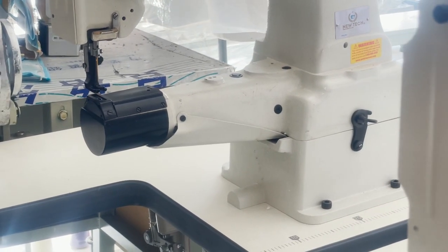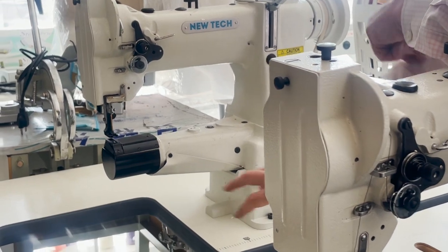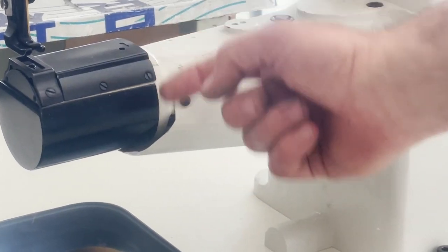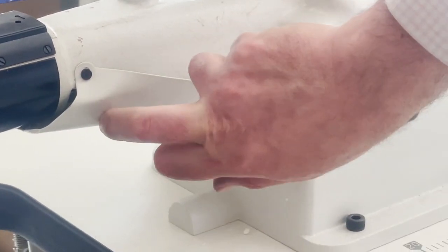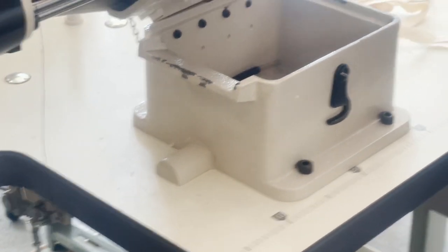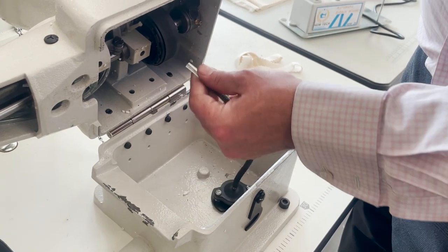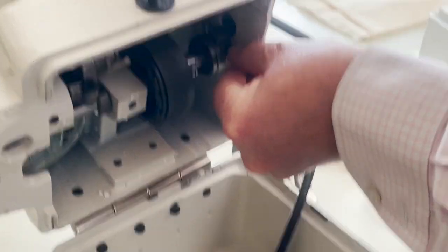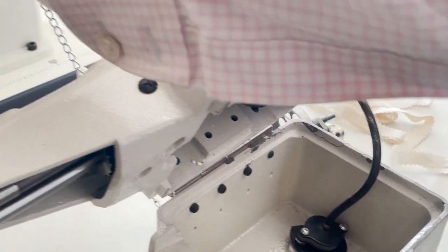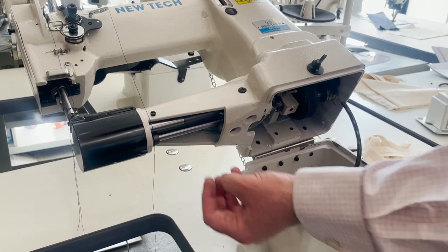Even the most sophisticated, fully automatic sewing machine has a drop or two of oil. But the way it works is you have to have this piece here. When the oil is inside and it's pumping, the oil might drop from back here, and this piece is there to take the oil and return it to the reservoir. You see — the oil goes in here. This is the pump. You fill this up with oil, it pumps in and goes inside the machine. When all these gears are moving and turning while you're working hard, a drop or two of oil will come up and drop.